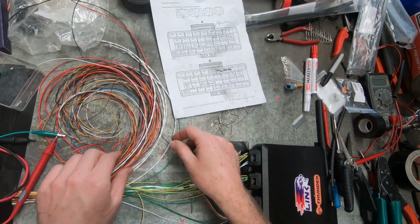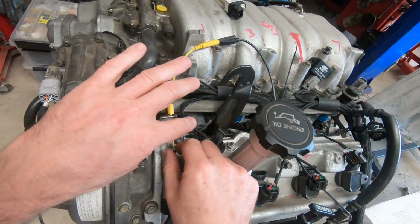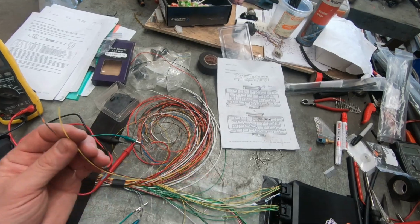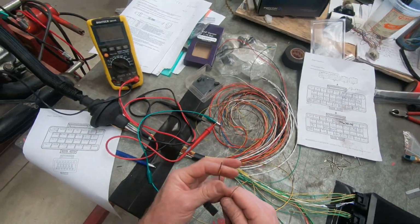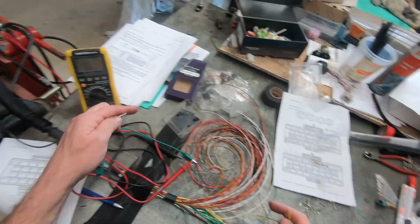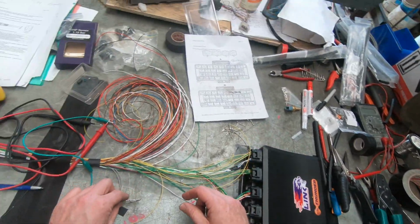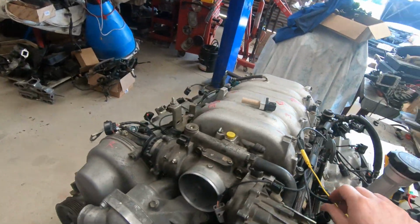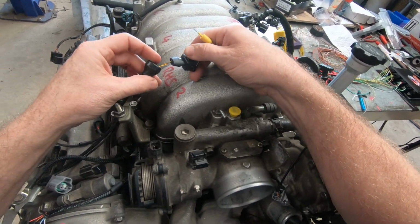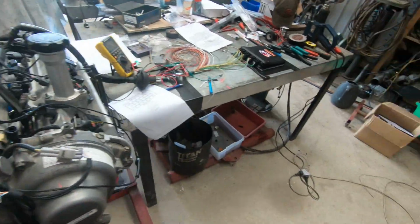In here, find the yellow wire. Is it a straight yellow? It has to be that one because it's with a twisted black orange. There it is there. So that's my air temp. I go over to the water temp. It's another yellow wire, but it's a yellow orange.